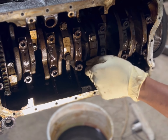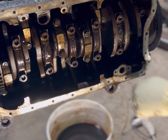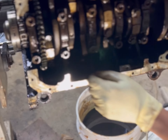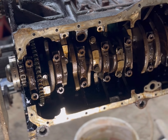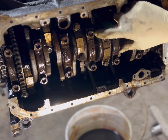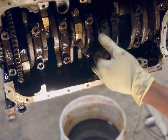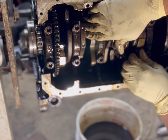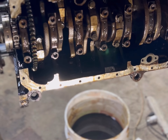Knock knock - that's what a spun bearing looks and sounds like. It's supposed to be tight like this. Checking them - number one, two, three... nope, it's number four. And that's all folks.